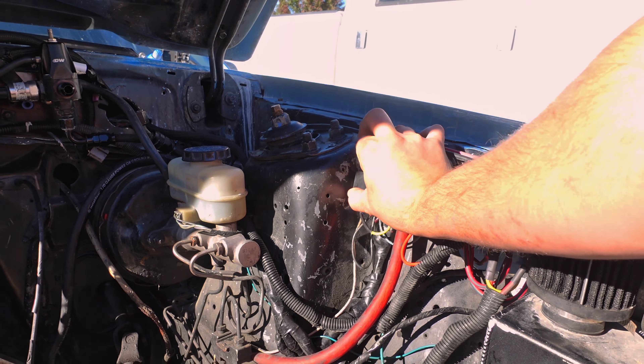I got a paintbrush and some cleaner and cleaned it out as best I could. Then I cleaned all the connectors out, just to play it safe, because I would venture to guess that was definitely an issue. I should have gotten a picture — it was corroded bad. Then I covered everything in dielectric grease. I'm not sure how it happened, but hopefully it doesn't happen again.